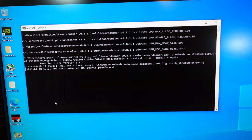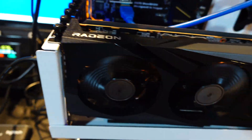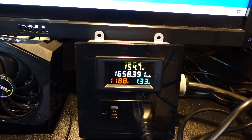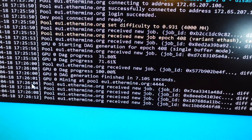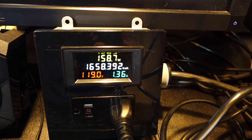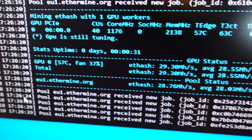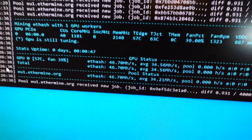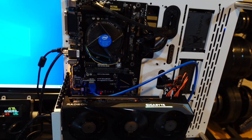Let's start the miner. What we're going to look for now is can we maintain that 47 megahash, and what kind of wattage can we pull from the wall. DAG is being built, fans just started spinning. Right now we're pulling about 155-160 watts. DAG's built. Look how much wattage we already cut down — right now we're pulling about 130 watts from this GPU. Let's see if we kept that megahash. GPU still tuning — about 30 megahash right now. Let's hit S to refresh — 46.7. Much better. 46.7 at 130 watts.